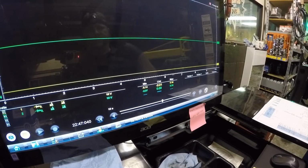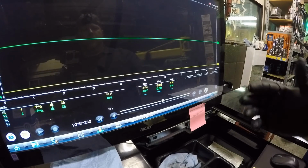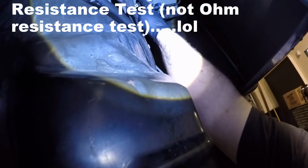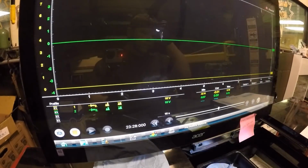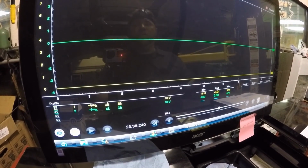The other system, like I said, if you disconnected the wire and it didn't have the internal resistor on that driver or on that regulated circuit, it would show as 0. In that case, you would have to run an ohm resistance test. Unplug the connector, then check resistance between here and the PCM. Disconnect the connector at the PCM and check for resistance. That'll tell you whether your problem is indeed the sensor, or an open circuit in that signal wire going to the PCM, or if it's grounded somewhere.